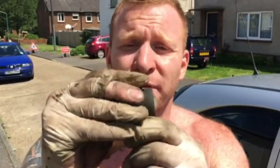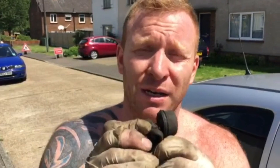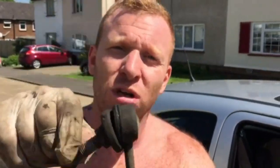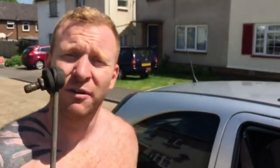So you can quickly watch and learn how to change it if you need updating. Here, this is a track rod end — it's perished. If the rubber is perished, that is an MOT failure. I purchased this car with an MOT, yet the rubber has perished and there is too much play on the end. This should be so sturdy — you'll see the difference on the new track rod end. Here we go.